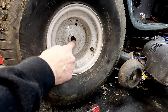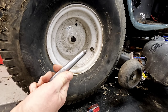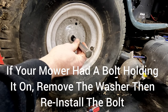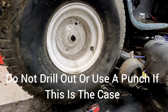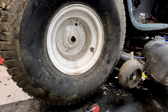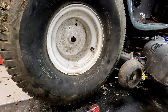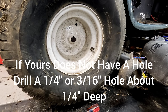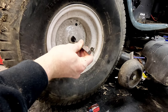If it's difficult to get off and doesn't just pull straight off, the first thing I like to use is a nice center punch. This one has a little nipple on the outside edge that you can put in real easily. Hitting from there isn't going to damage the outside edge. A 2x4 in between the tire at the back and the frame works very well — or a pry bar — to get in between and pry it off while somebody hits on the outside edge with a punch or center punch. If your punch won't fit into that hole and won't stay put, go ahead and drill that hole out a little bit to give you more room to get a good bite on it.